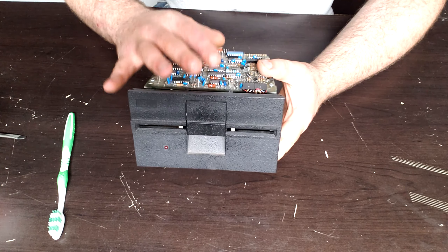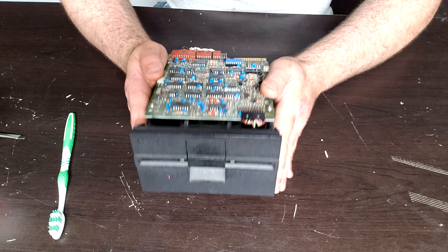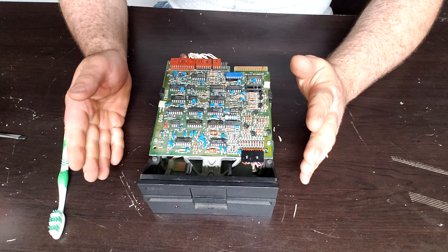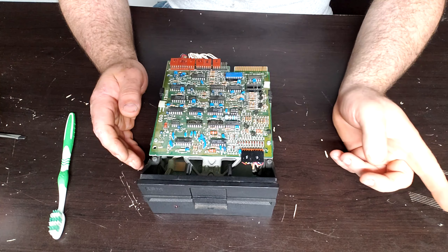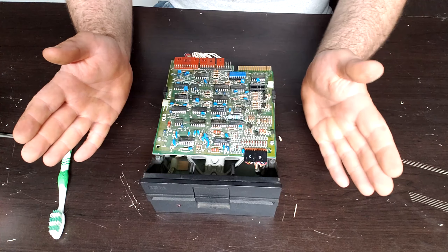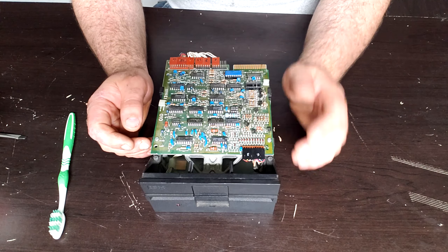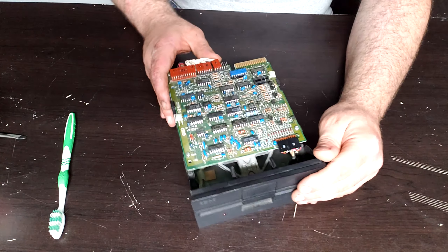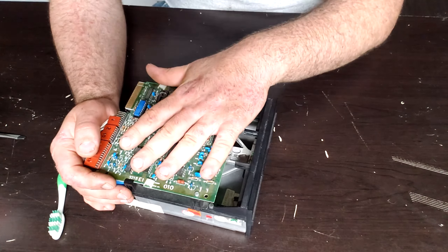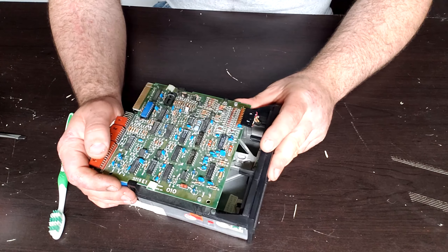I think this disc and the controller are compatible for writing. If I could get a disc image on a CF card adapter, the machine should boot from that, and then I should be able to write the appropriate DOS floppy — like PC DOS 1.0 or 2.0 — using this drive. But this is going to be cleaned up and fully refreshed in part two.